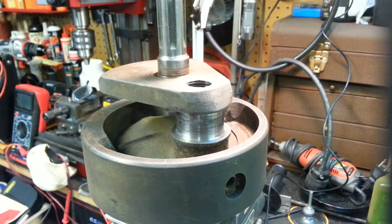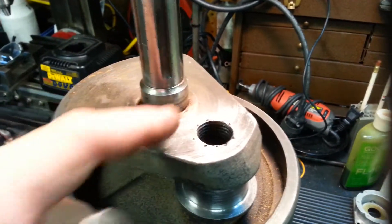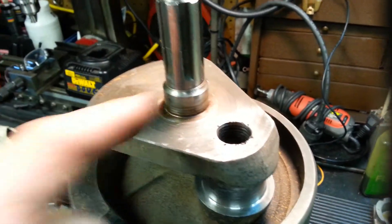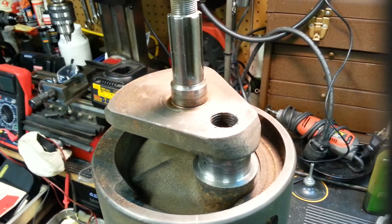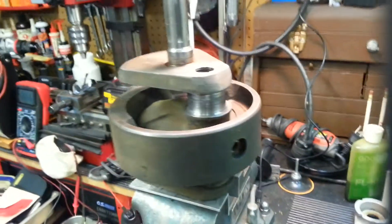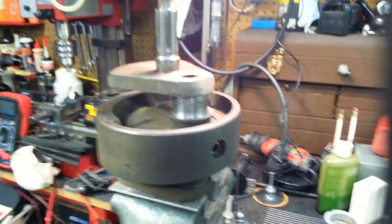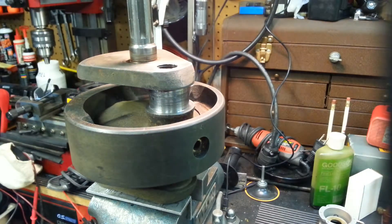When I got the plug out, I cleaned all the little burrs that someone had put with a prick punch to hold it in better. It's nice and clean, the threads are nice, and I'll buy a replacement plug for each side. Going back to the journals — this journal is scarred, and we're going to end up regrinding both sides. But this one is scarred, so it's definitely going to have to get reground.